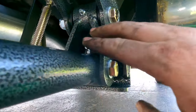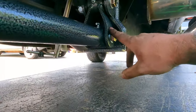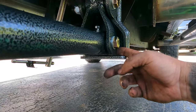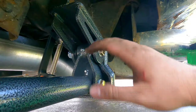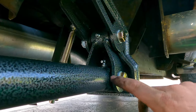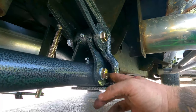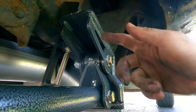When you're lining this all up, the bottom of the traction bar — per the instructions — needs to be touching the bump stop at ride height. So make sure when you dry fit this, before you mark your holes and drill anything, you make sure that your traction bar is right against that bump stop. Once you get that touching the bump stop and it's supported back there, go ahead, mark your holes and drill your holes.